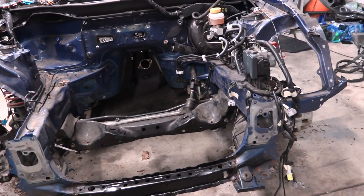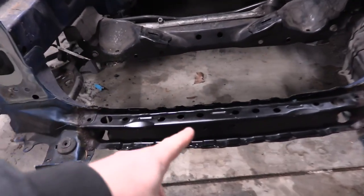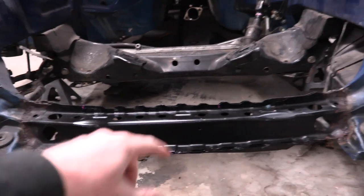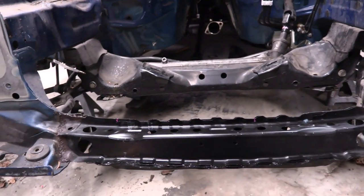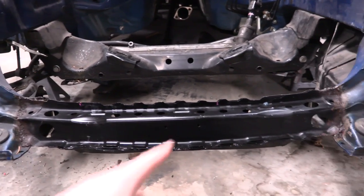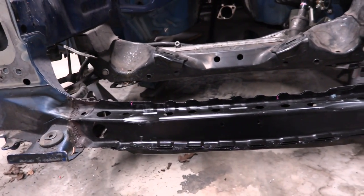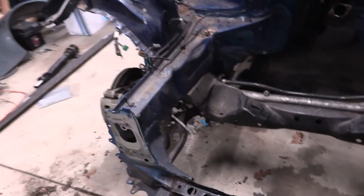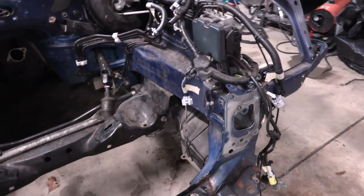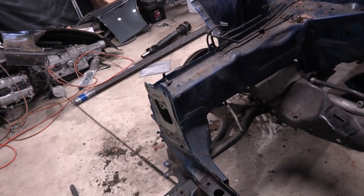The next thing I want to do is some welding. We have a couple of little projects to hit with the welder before we move on to cleaning up and painting. This thing needs to be lowered down a little bit — I need to essentially remove that lip and maybe bend this down just a little bit. I wish I could cut a channel and weld a nice piece of metal in there, but everything I have is too heavy duty a gauge. So right where those lines are, that's where it's going to get cut, folded over, and smooshed down to make room for the engine. Also there are some crinkles in my frame rails that weren't supposed to be there — I sent this to a frame straightener but unfortunately those guys will scam you, and that's exactly what happened.